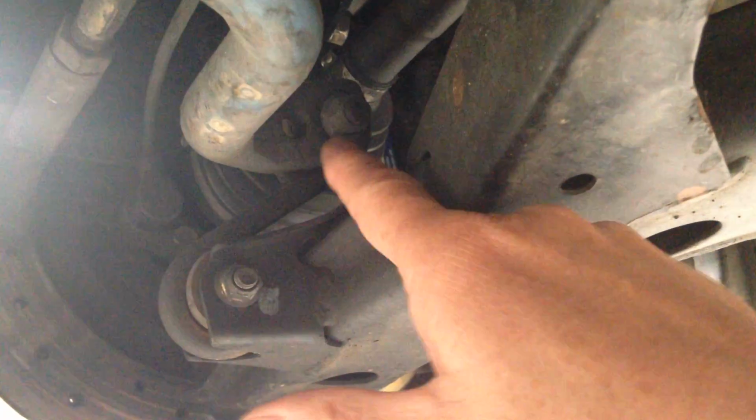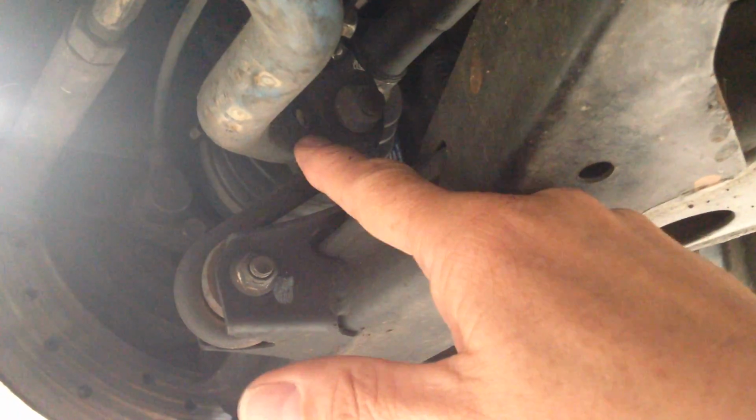If we come around on the inside, you can see it's got one of the very early Whiteline adjustable sway bars, which in those days were painted blue with the 2 holes. Of course on that setting there, it's on soft, and when you move the bar pivot point forward, that actually makes the front end a little bit stiffer in the way the sway bar operates.